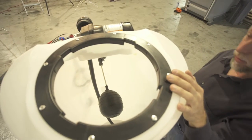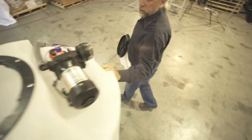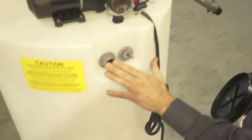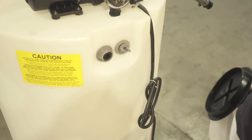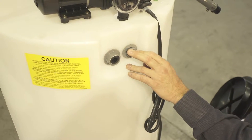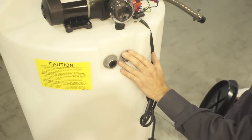They could be filled from outside the trailer, and if you spin around here to the front side you'll see those connections here. Now this would be connected to your fill valve here that you saw inside. This line would be connected to a line that you would plumb outside your trailer that would serve as an overflow, and that would also be an indicator for when your tank is filled when you see water coming out of that supply line.